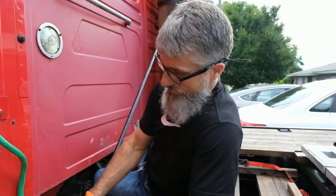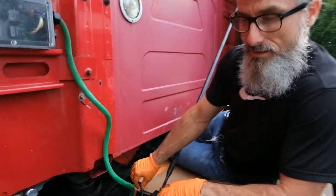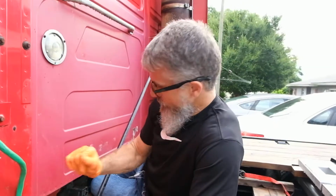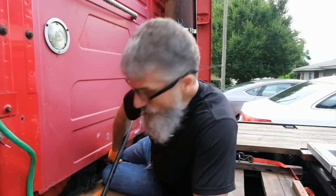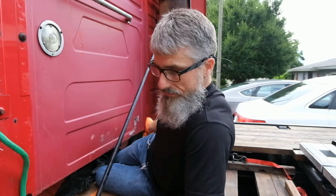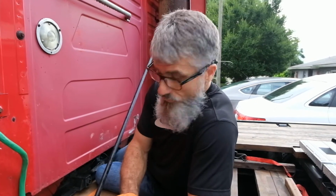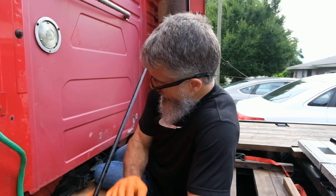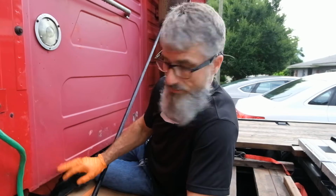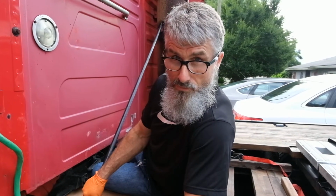Once the bag rubber has been removed, we will cap this line, air the truck up, and use our valve to use that cab bag to lift the cab off of the old assembly. We will put a couple of blocks of wood between the cab and the frame as dunnage to protect ourselves while we're working under here.